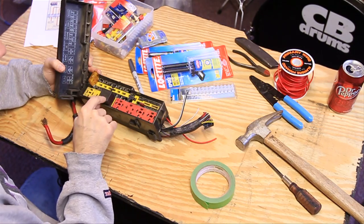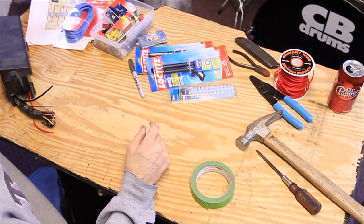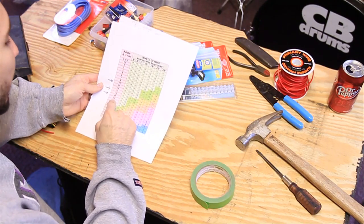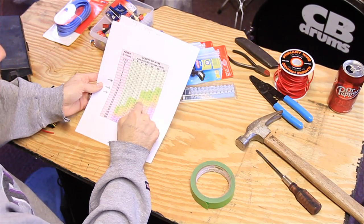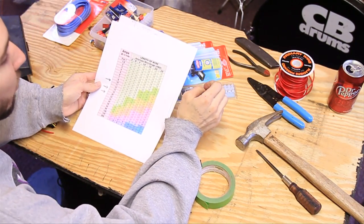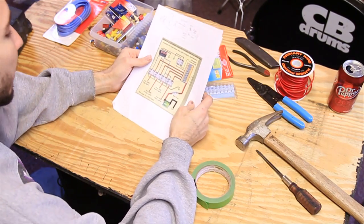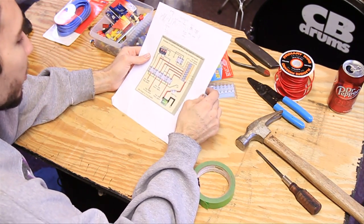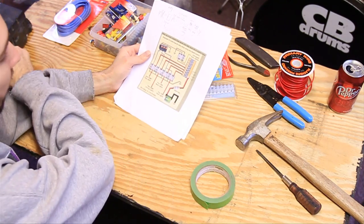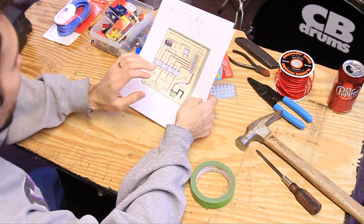Make sure to get enough maxi fuses, relays, and mini fuses - probably more than you'll need. In the description below I've got two links: one is to a chart that shows you the amperage, length of wire, and what gauge you'll need. I'm going to use 14 gauge wire. If you're going to have high wattage lights requiring more than about 200 watts, go with 12 gauge or even 10 gauge. The second link is a wiring diagram from surgeecal.com - it shows exactly how to wire everything up. Read it, study it, and understand it before you start.